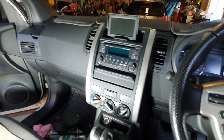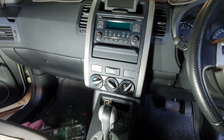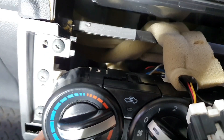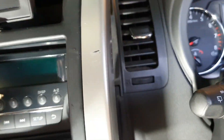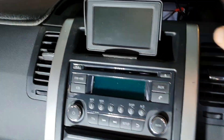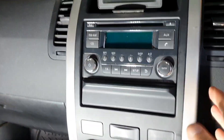Dashboard is all back together - kick panels and everything. If you found this video useful, please leave a like or a comment. Actually, I left out a couple of screws - there are three screws each side of that panel, so I had to pull it off again to get them back in. The easiest way to get it off is to put your fingers in from the top and yank it out from the top first, then work your way down.